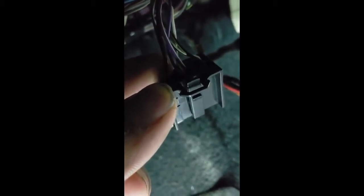Then go down under the dash. Remove the kick plate and remove connector E, right up in there — I removed this one just to get better access. You're going to insert the other end of that yellow trigger wire. I believe it goes right next to the purple wire at E13.